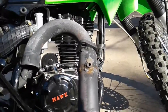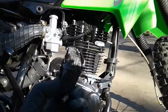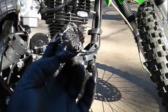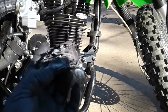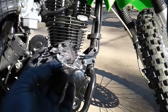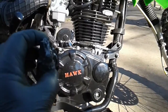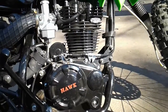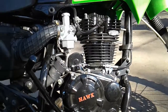I got at the header and cleaned it out. It had a catalytic converter inside. The idea of that thing is to heat up the fuel and heat the pipe up, so any spent liquid gasoline would be burned before it entered the silencer. Well, that's gone now — hopefully this clears up my heat problem, which it should.